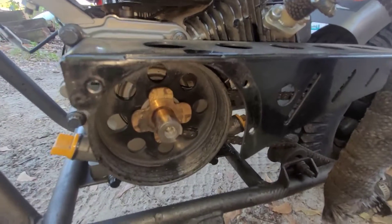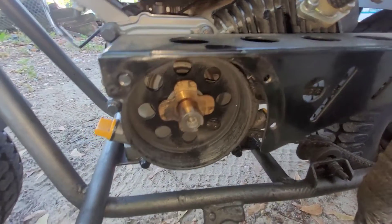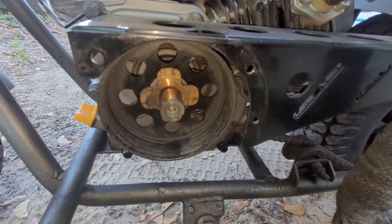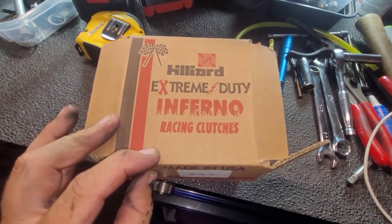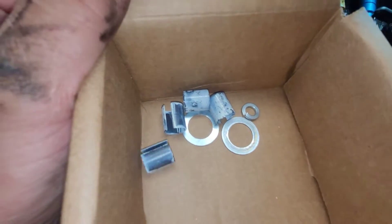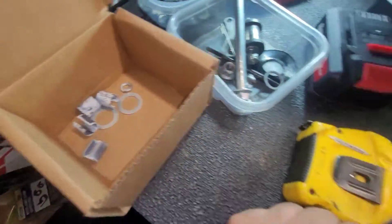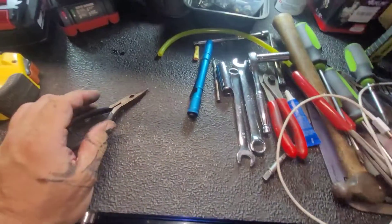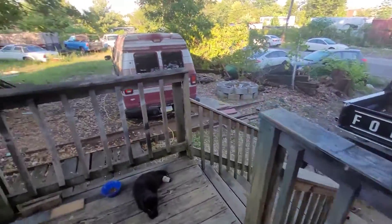It's an $85 unit — a Hillard Extreme Racing, I believe it's called. I'll show the box in a second. It comes with springs that I believe stall at 2800, and the springs on it now stall at 3000. It's got a removable sprocket on it — you can change the sprocket out. It doesn't look that much different than the other one other than the removable sprocket.